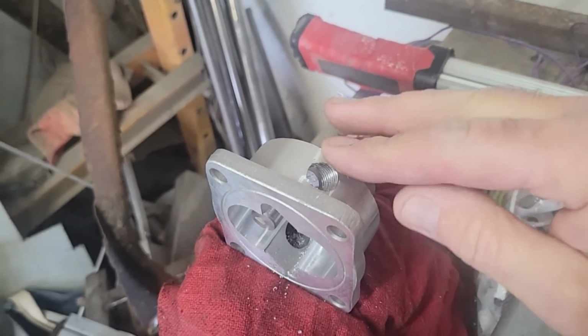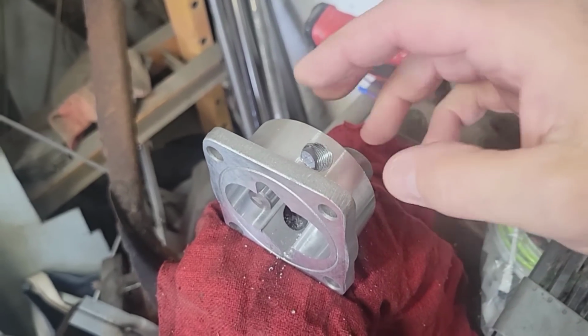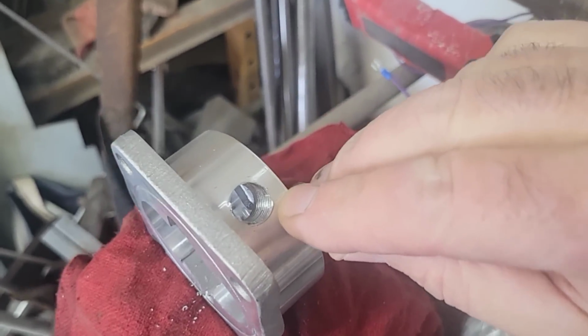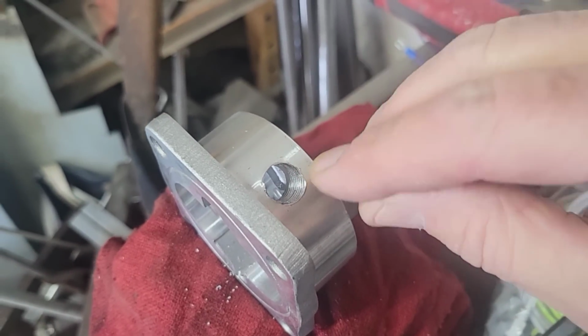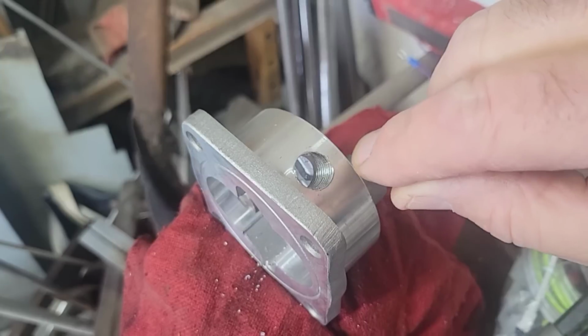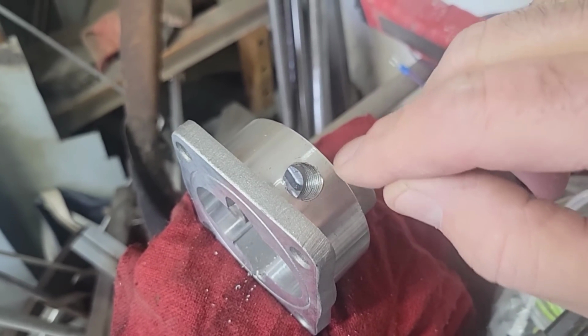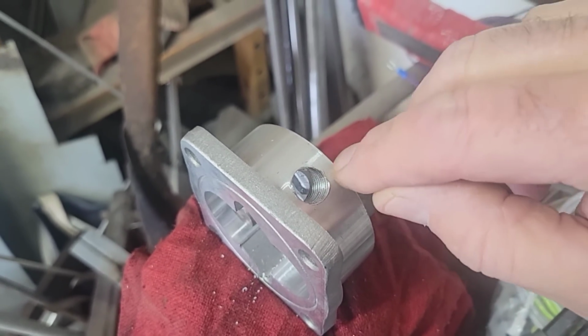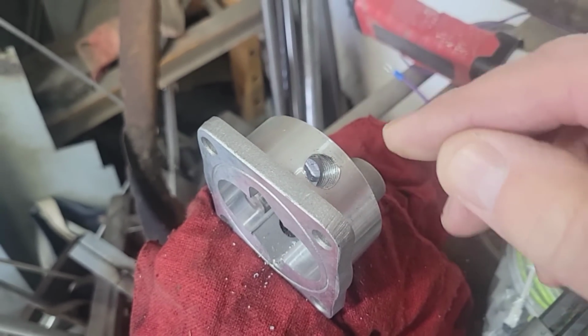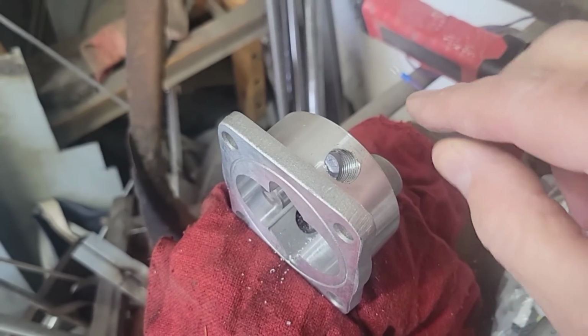The problems when you use the brass, okay, if you grind it off, now if you kiss that grinder along this edge right here, you better put both plugs in, because this is probably where guys are saying that they have an issue. If you take any metal off of this, the other side of the case is going to leak in.